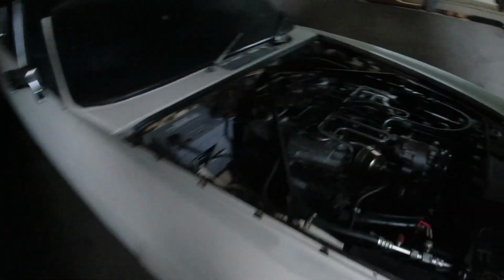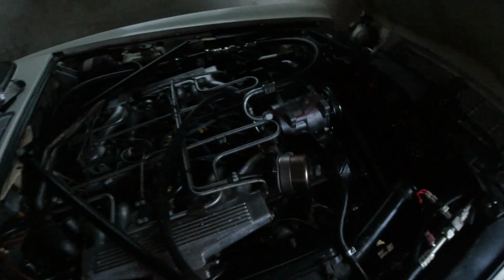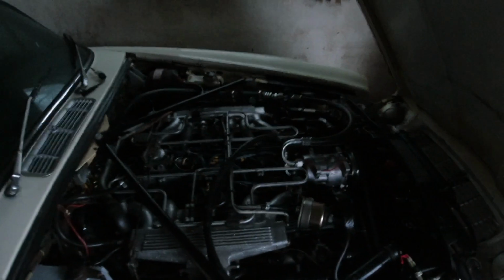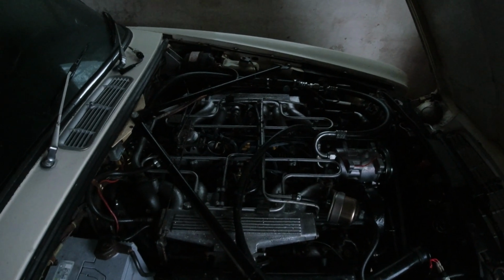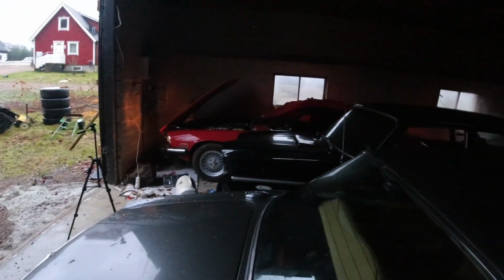But now I'm getting a lot every single day. So this whole engine bay is so moist. I'm wondering if I have moisture inside the distributor cap and it's just throwing sparks like crazy. I just checked that we have spark, but not at the right time. And it definitely smells of fuel. So I think the injectors are working, all of that, just not this. But hey, one V12 out of two ain't bad.